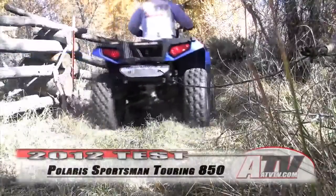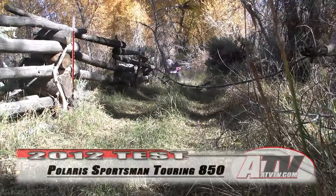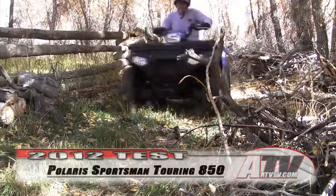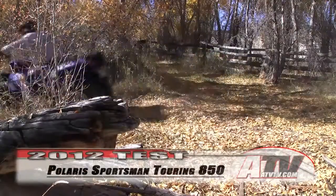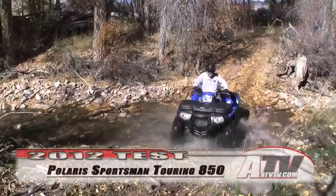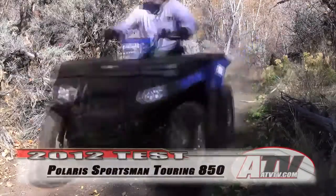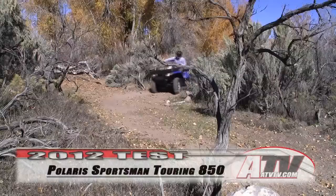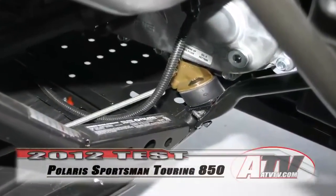The longitudinally mounted, single overhead cam 850cc twin-cylinder engine is fuel-injected for easy starting and smooth running at any elevation or weather condition. And rated at 71 horsepower, the 850 has more than enough power for any situation. Now, because the engine is mounted longitudinally, the CVT transmission now sits behind the engine rather than alongside it. And that arrangement makes the XP a whopping 8 inches narrower than the older standard Sportsman. Now, both the engine and transmission are rubber mounted in the round tubing double cradle frame for less vibration and noise transfer up through the frame to the rider.